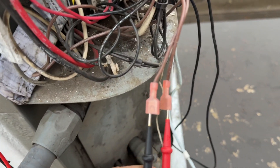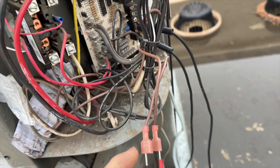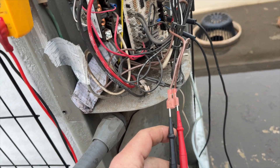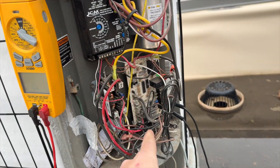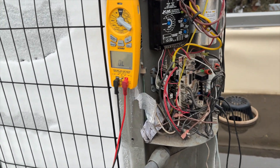The unit came out of defrost early. It's obviously still frozen. I think my sensor's messed up — it's resetting too quickly, or maybe it's a positioning issue. I need to get this thing defrosted, so I'm going to jump out that line and put it back into defrost until it's actually melted all the way.